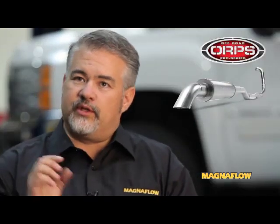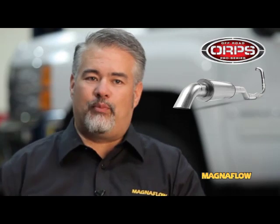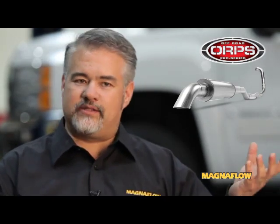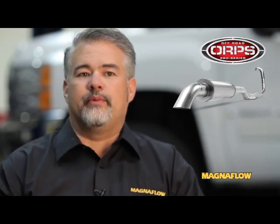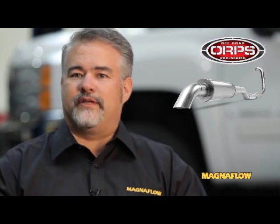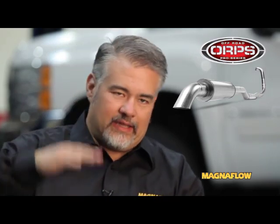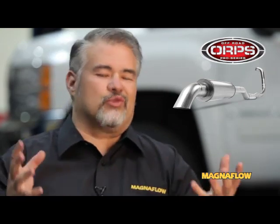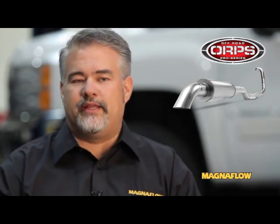If you're really looking for something to fit a budget, we've offered two new systems this year. The Off-Road Pro Series is an unusual system in that it doesn't have a tailpipe. You get all the features. If it's a turbo back, it starts at the turbo. If it's a cat back, it starts behind the cat. But the system terminates just before the axle. In particular, this system allows the usage of exotic suspensions. If you have a vehicle that's highly lifted, or if you've got a fifth wheel for trailering, it provides the extra room you need and a turn down that's hidden behind the axle.